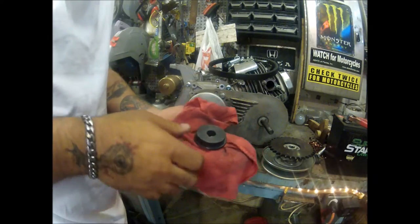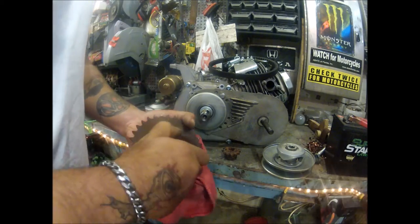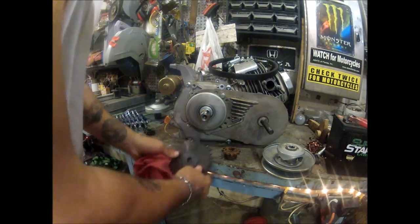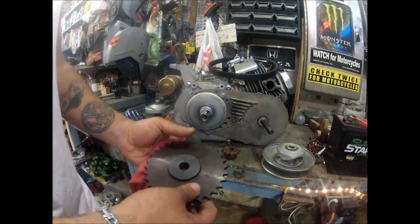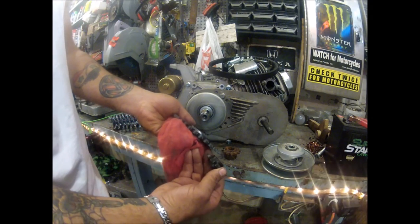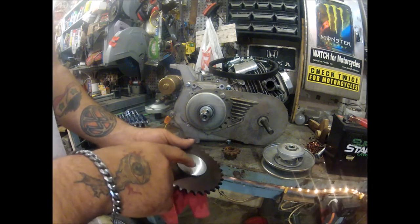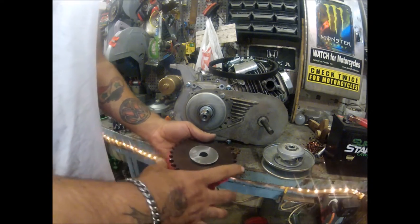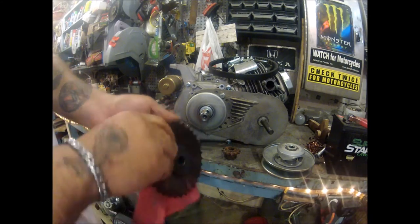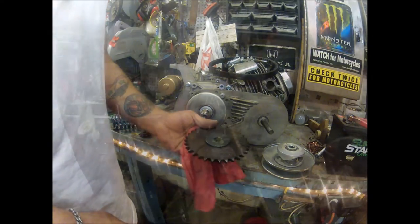The hub is extremely hot right now and it's about to get hotter. The next step is to take my 32-tooth gear and thread it through here — put it around and that's basically my gear right there. This is basically imitating that original piece — the only difference is I'm going from a 10-tooth to a 32-tooth. After making this I realized I should have bought two hubs so I could cut another one down and get it to the right thickness and buy my other gear — I'll do that this week so I can play around with different gearing.